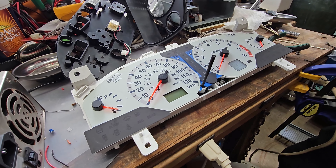Reconnect the white plug as well - push it in and get the tab in too, that one is back in place. The last plug is the far right one - rotate the cluster out a little to get some slack. Same concept as the others: get it started, push down on the pin, and snap it in place. Alright, the cluster is reinstalled with all the plugs back in. Set it down - moment of truth. We're going to see what all the needles look like, but we're mainly interested in what the fuel needle looks like, since that is the main issue everyone's been having.